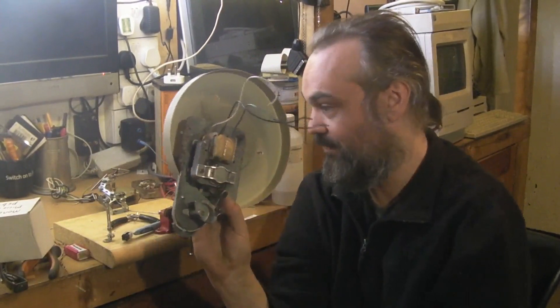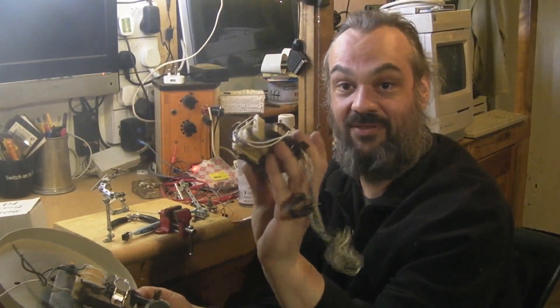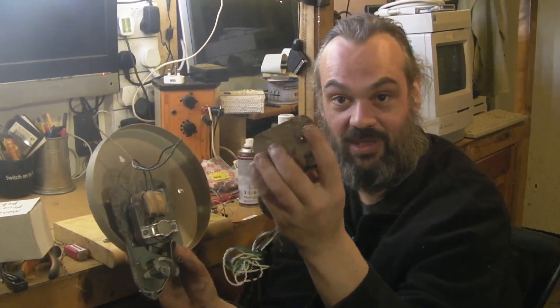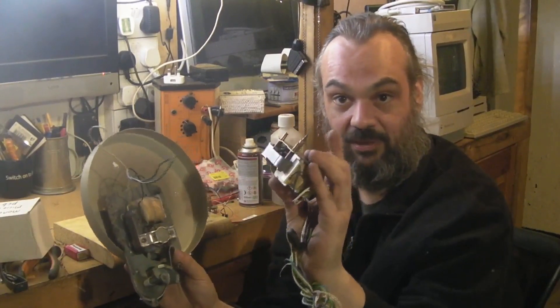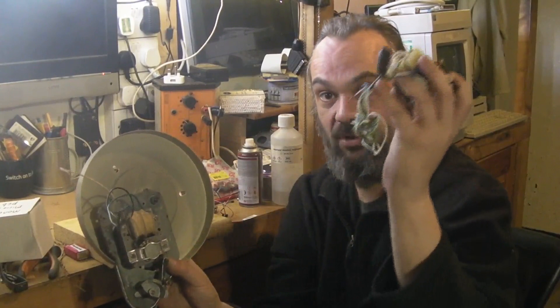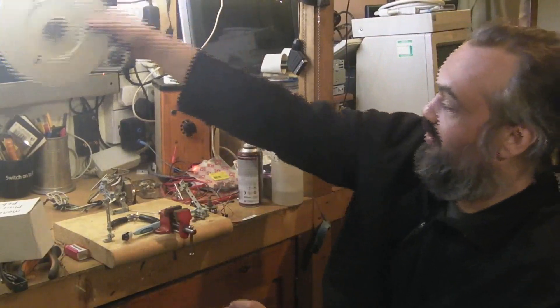So I'm going to go with this deck for the project. This one has got the 90 volt tapping on it, but what it means is we can use the windings off Andy's motor and use the spindle off this motor. Andy's is a brand new old stock motor, never been used, so the bearings will be better. We'll whip the spindle out of this one, put it into Andy's motor, and mount it. That'll give us our low voltage output off the transformer to drive the IC and transistorised amplifier.